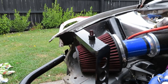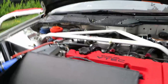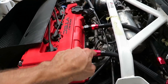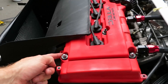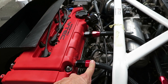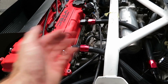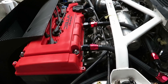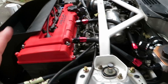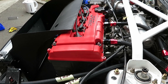The catch can — most people come out the front, but I simply didn't have the room so I'm going to give it a crack out the back and into the catch can. If it starts pumping too much oil out, I'll probably have to whip the cover off again and weld my own baffle in there. I'm not sure how it'll go, but I think it's going to be okay — wait and see.